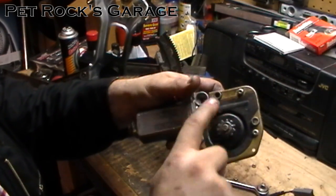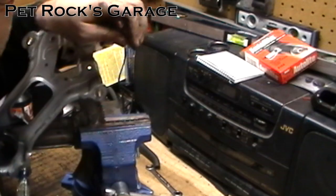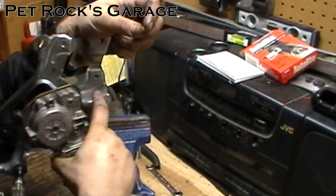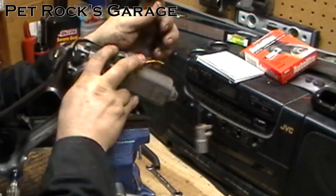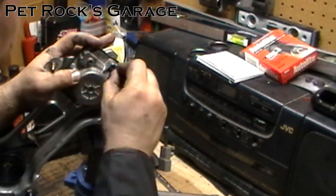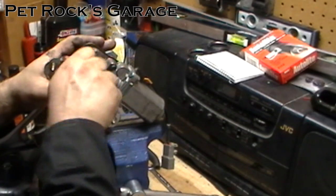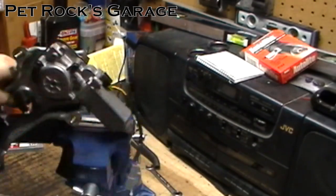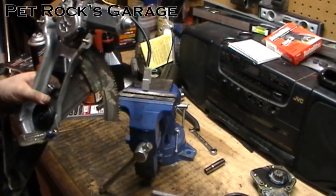Because I have the screwdriver in, it only goes up so far. Now take a little bit of chassis grease and put it all around the gear of your new-to-you motor. Take the new motor, press down on the arm, and slide the pin — the tip of the motor — into the hole, making sure it catches on the cogs. Once you've got it in, keep pressure on it and start a couple of bolts. Don't let go until you've put all the bolts in a couple of threads. Then snug the bolts down, and make sure you didn't accidentally bend the shaft.